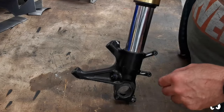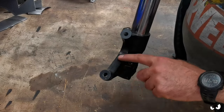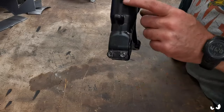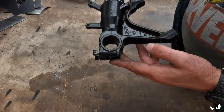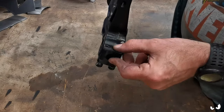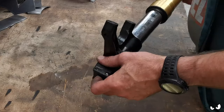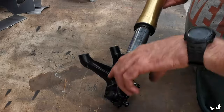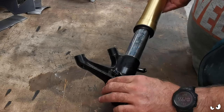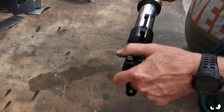We're going to delete these lugs, and then we're going to sort out all these little casting marks. So look, there's one that runs down the middle there. There's another one down here. There's a few nicks and dinks and stuff in it. It's a bit grotty, and we tidied up the yokes and they came up a treat, and they just look real simple. Just all smoothed out, plain looking. That's all I want to do on these, basically.